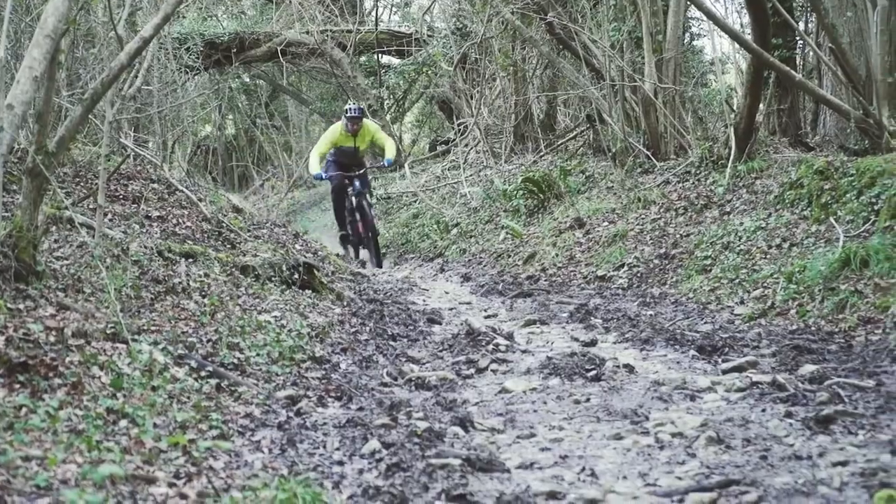Yes, you can get some benefits from it, but do you really want to do this on a mountain bike? The more important thing on a mountain bike — given the loads of friction where we ride, unlike a road bike — is the surface conditions, the compound of the rubber on your tire, the pressure you run, the volume of your tire, the suspension. There are so many different things that factor in that I don't think you're going to get much of a performance increase in efficiency compared to just using any decent chain lubricant. Use a wet or dry lube according to your conditions. Ceramic-based lubes will last longer on a chain, but I'm not convinced waxing is of benefit unless you specialize in out-and-out cross-country racing. Has anyone out there waxed their chain? Should we try it on GMBN Tech? Let us know in the comments.